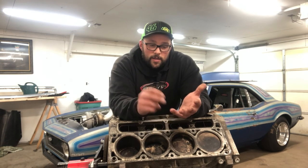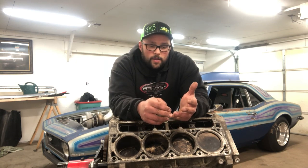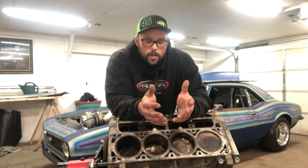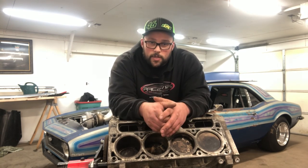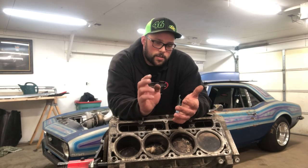I'm not a cam expert — I'm not going to recommend which one you should use. You're going to need valve springs that can handle it. I went with the BTR 685 Ultimates, probably overkill. You could probably run 660s or PAC 1218s. That's what I used and it ended up running about $360 for the kit, which had new seals, retainers, springs, and everything.